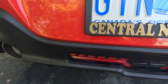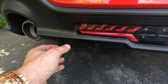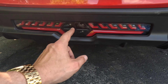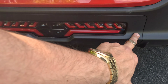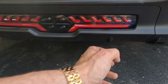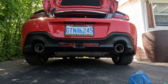I didn't really realize, but I guess I was taking pictures not videos. Throw this back on — your wiring harness will be right there. You want to zip tie it up, tuck it in, make sure it's all good to go. Put the two fasteners in — there's one middle one that just clips in and holds it in, and then there are two 10mm bolts that you tuck off and screw back in just nice and tight. You don't want to break it. Throw your three clips in and — boom, voila. Let's show you the running sequence. Fingers crossed it works. It would help if I had the key.